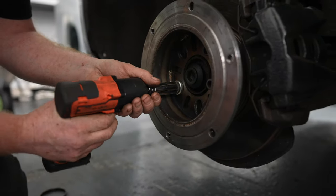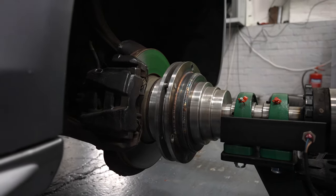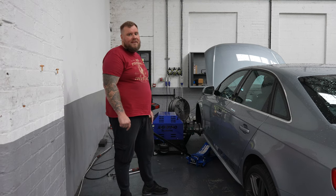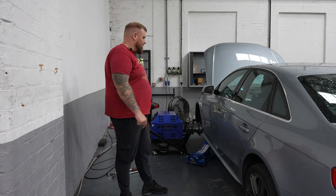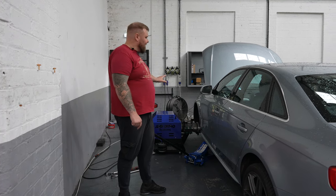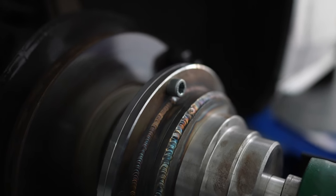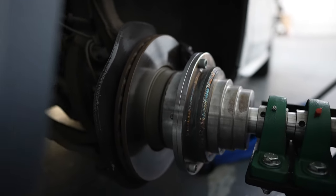They've been attached via the wheel studs to the hub itself. And then there's an opposing connection to the hub dyno itself. There's three dowels that locate it quite easily with the use of some air and the jacks that remain underneath the vehicle at all times. There's three fixings that are screwed in. They're Allen key style fixings that join the two couplings together, or the hubs together.